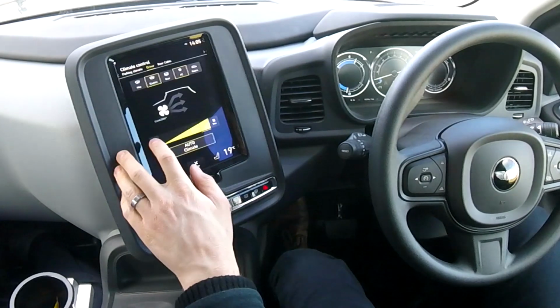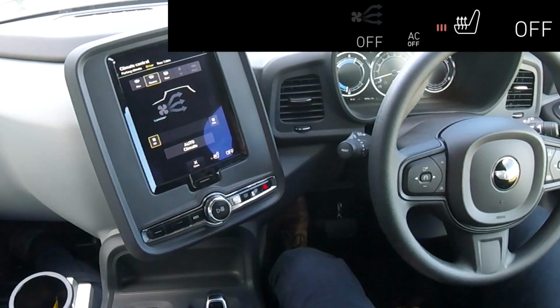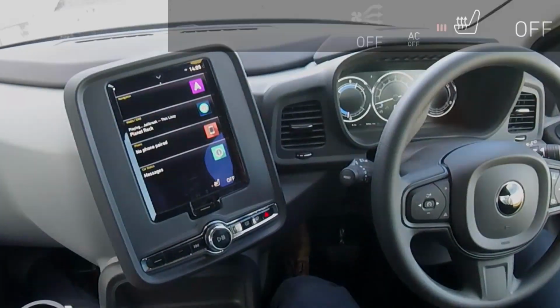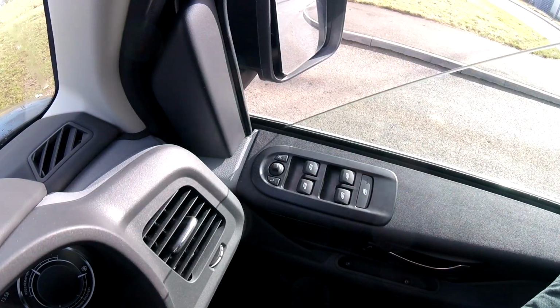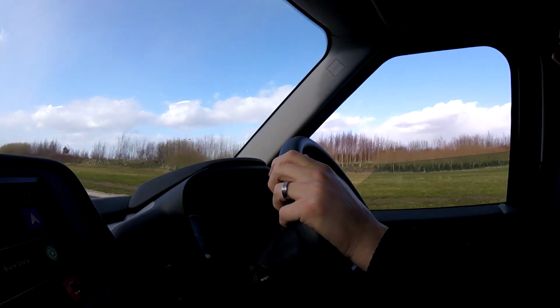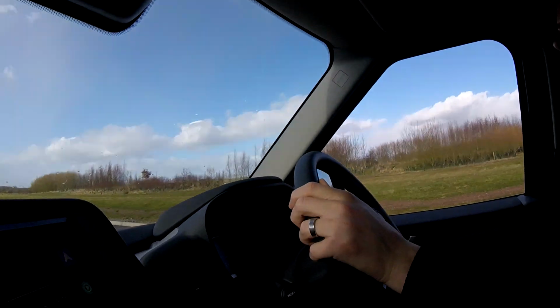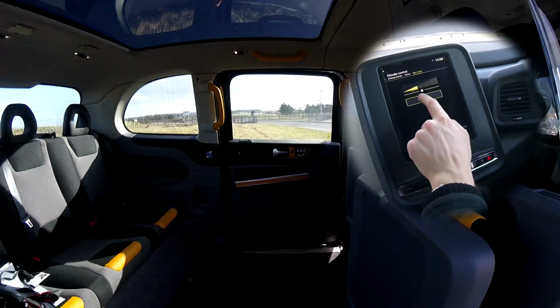Switch on your heated seat to maintain a comfortable temperature, instead of turning up the cabin heating, which has to warm a large volume of air and is therefore far less effective. On a hot day, open a window at slow speeds instead of turning up the air conditioning. Never do both. That freshly cooled air will disappear outside, making the system work much harder to maintain the desired temperature. And if there's no passengers on board, switch off the rear zone to reduce energy consumption.